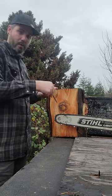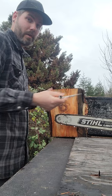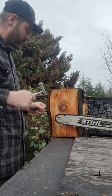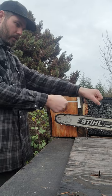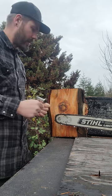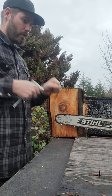If you just walk up to a piece of wood and try to jam it in, it's going to walk right away from you — and it's going to be fast. My saws are spinning at 14,500 RPMs, they're hot. You just can't jam it straight into a tree. Someone who doesn't know what they're doing is going to do that and it's going to kick back. Professionals know how to work the tip of their saw.